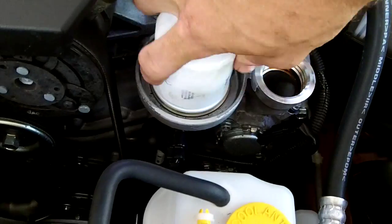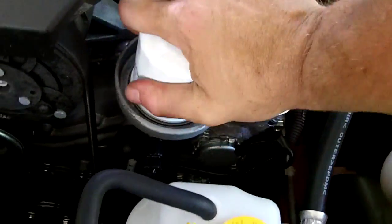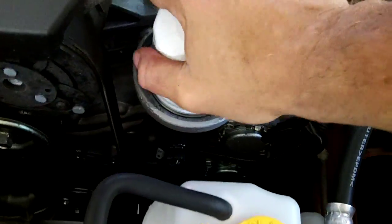A new filter — it's just sweet the way they've got these filters now. A lot of vehicles are doing this style. You just want to touch and go another half turn to three-quarter turn — it's not going anywhere. Hand tight — that way you put it on hand tight and get it off hand tight.